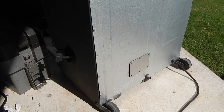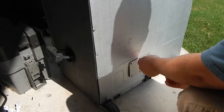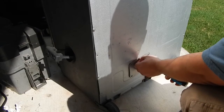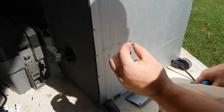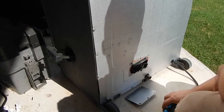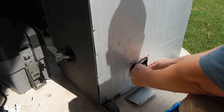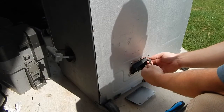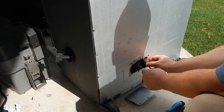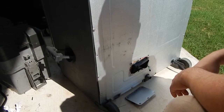I've gone ahead and removed all the screws but one. The screws I used are about 3/8 quarter-inch — I think it's a number 10 if I remember correctly. According to the Masterbuilt instructions, we need to take these spades off, which we do because they're corroded pretty badly — all rusted. That was a temporary one I put on for testing. We'll use wire nuts to put on the new spades and go from there.